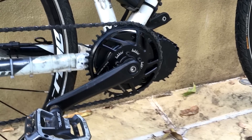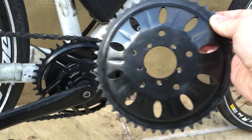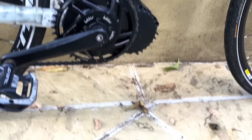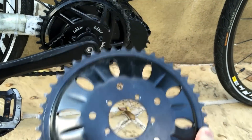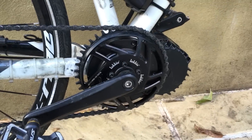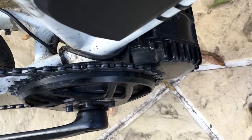I just wanted to show you what came with the BBSHD. This is the original steel chain ring — they're called sunflower on some websites — that came with it. Now this is okay, it's got a fair bit of torque and is quite powerful, but it's really clunky. To be honest, I felt like it was pretty unsafe. I did snap a chain with this one the first week I had it, and I had some alignment issues where the chain was actually popping off and getting stuck.